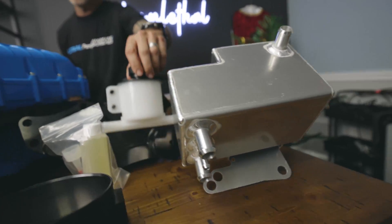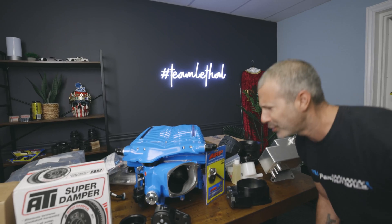In addition to the intercooler that's sitting under the lid on the supercharger itself, Whipple provides a whole bunch of other stuff for your intercooler system including this high flow intercooler pump, a couple of reservoirs — Whipple's got a real nice aluminum tank as your reservoir and a reservoir fill tank. Along with the hoses, this will complete your intercooler system, and you can run an aftermarket trunk mount tank if you'd like — which I plan on doing from PNR. For guys running these on Coyotes, this blower is very large on an 11 and up Mustang GT and will not clear the factory hood without the BMR engine lowering brackets, which lower the engine about a half inch. On my Cobra I'm running a cowl hood so I'm not sure if I'll need them.